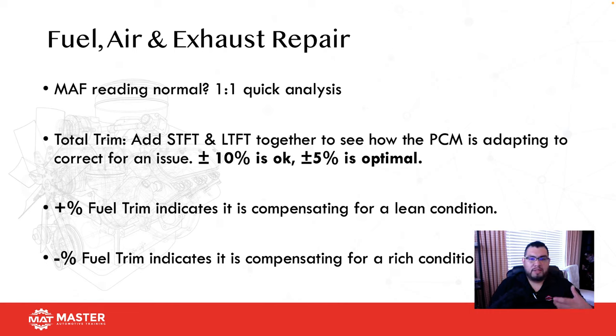So a car comes in, you guys are servicing it, and then you have to go for a test drive. Well, plug in your scanner, take it for a test drive, record all that data. Obviously, you're not going to come back and review it, but save it. And then when you have time, because you guys have time, go back and relook at the data. This way you start picking up what is good, so when a bad car comes in, it's going to slap you in the face. However, if you don't have any of that, here's a good way of doing it.